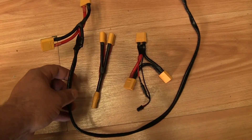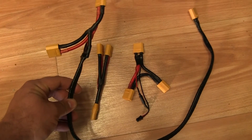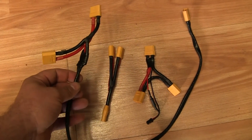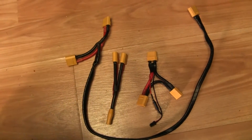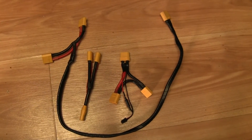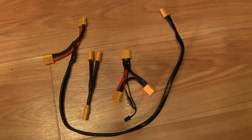And this is a parallel extended wire, meaning if you have a rear bag and rack system and want to add a second battery to your system, you would need this extended wiring harness to put your battery in parallel and double your distance. So these are the three wiring harnesses we have to add more than one battery to your system.